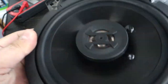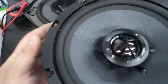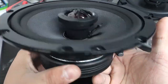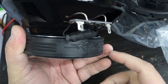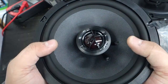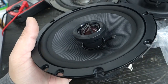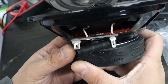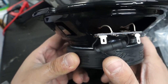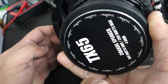For those who want to go really loud, here's the SCAR coaxial speaker. It can handle up to 100 watts RMS, and sensitivity is 89 dB — but again, it's a 4-ohm speaker, which puts it out of the ballpark for our use case. Now if you're going with an aftermarket amp and not using the factory amp, the resistance doesn't really matter to you. But if you're keeping the factory amp and just replacing the speakers, you want to pay attention to resistance.